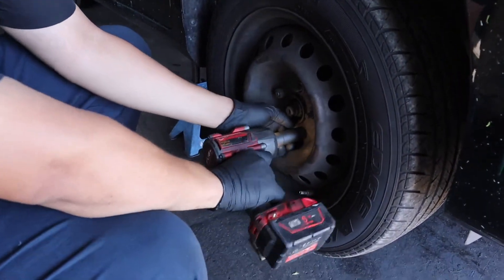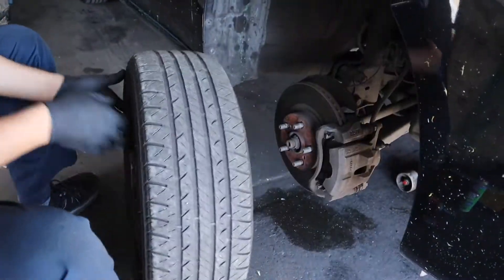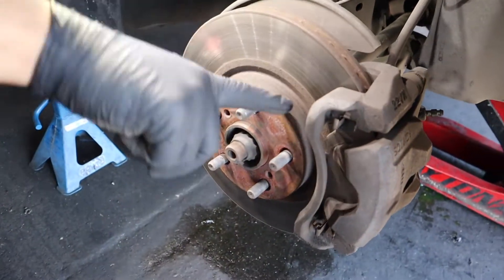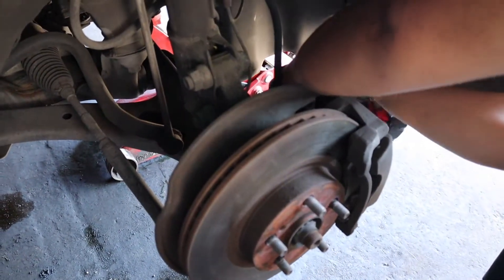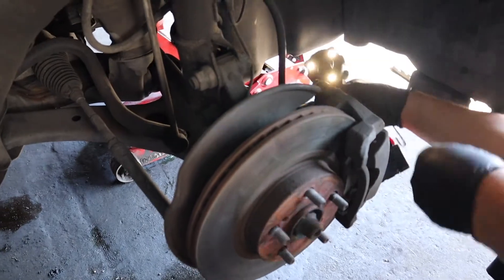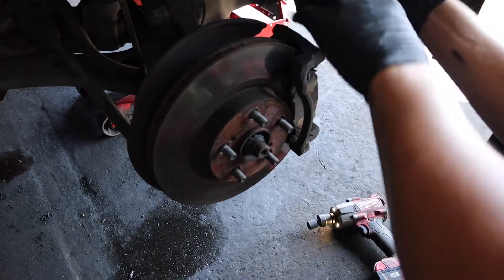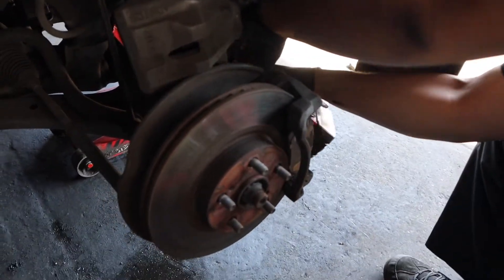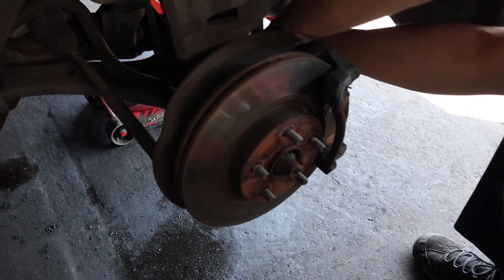This one has a 21, so you take those off. They're pretty tight. As you can see right there, the rotor is pretty rusted and the brake is really low — trying to get the camera in there but it's so low you can't really see it. So you want to get yourself a 14 millimeter, take those two off, release the caliper, and just hang it right there. There's 17 millimeters in the back — there's two of them — take off the bracket.